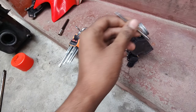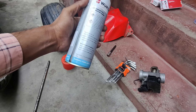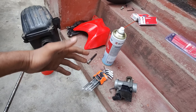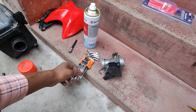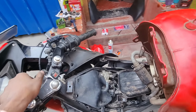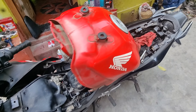All the sensors we have to open, and after opening you can clean or change them. I am going to use a throttle body cleaner. We will wash it and then see what results come. After fixing it, I will show you the results. Finally, we have fitted everything and will reset the bike 2-4 times. We put the tank back down because the oil was low, and we have installed new batteries.